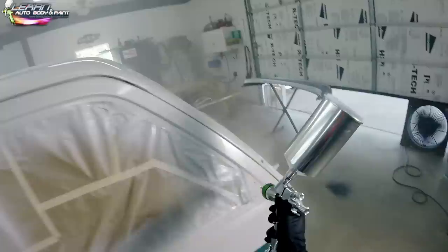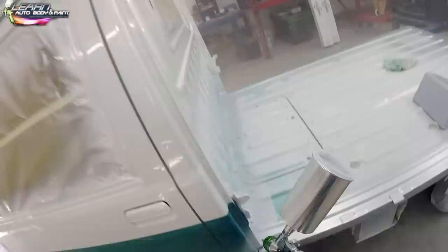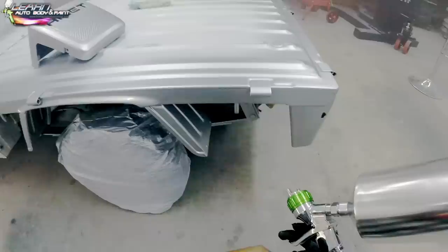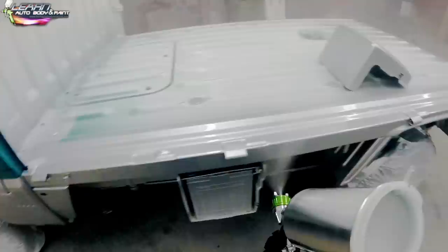The only time you don't want to run is if you have pearl in your clear coat, silver flake, or any flake or candy — you're literally going to mess up your paint job. Once you learn how to paint basic clear coat and figure out spray gun speed, pressure, and distance between panels without running, then step forward to advanced stuff like spraying with candies or mixing pearls or flakes in your clear coat. Instead of using a mid-coat, you can use the clear coat as your mid-coat, spray a coat or two, let it set up, then spray plain clear over it.